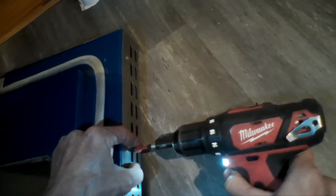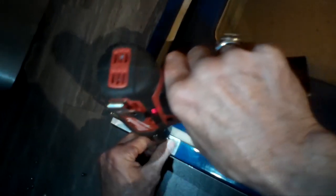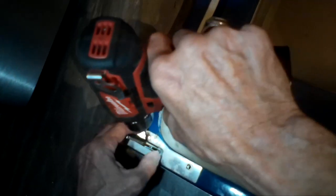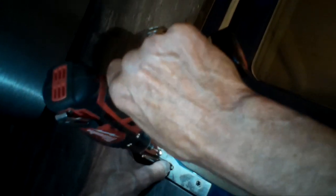It's common that when these hinges fail, if there's an LCD touchpad type keyboard, that heat will destroy the keyboard. So it's kind of a cascading effect — the hinges or springs get weak, the door doesn't close far enough, too much heat escapes, and then it destroys that touchpad. That's a pretty expensive repair. So it's good to keep an eye on this and make sure that your oven door can close all the way.